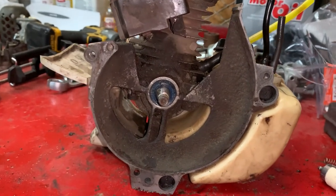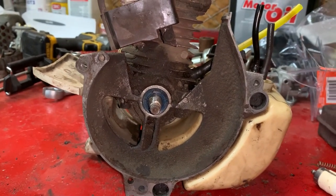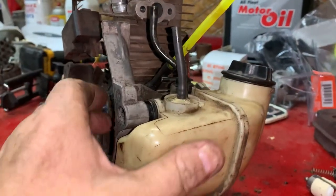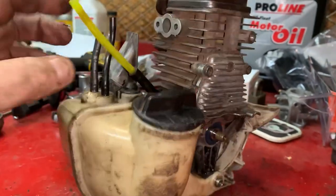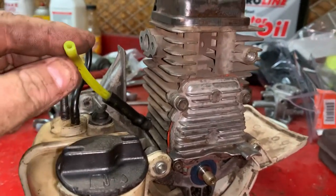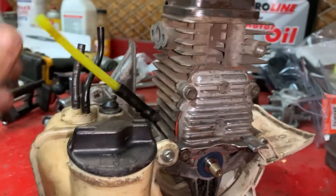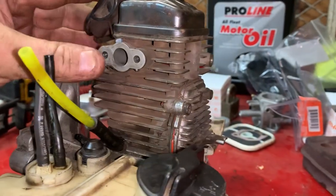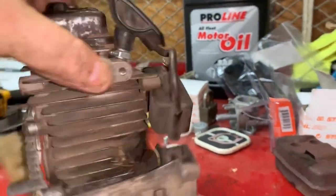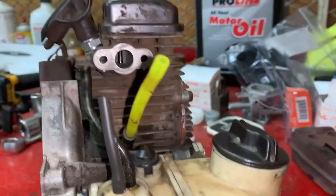What's up guys, More Medic One here. Real super quick video on how to diagnose a Stihl four-mix without any tools. All you need is a piece of Tygon to shove down into the impulse hose. You're basically going to use your human power — your breath — and use your mouth as suction. All you have to do is block off the intake and block off the exhaust with your fingers and give it a blow. It should hold pressure and hold vacuum.